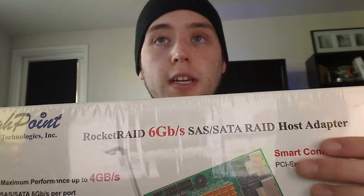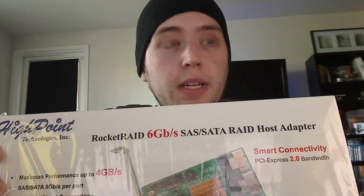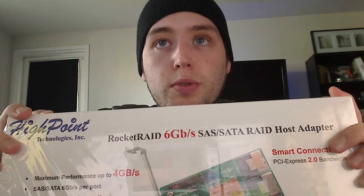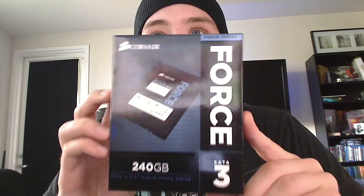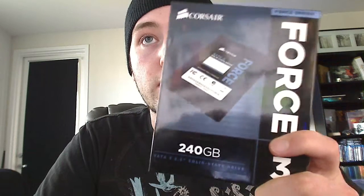It's got a maximum of four gigabytes a second. There are cheaper RAID cards around $34, but they only take up an X1 slot instead of an X8 PCIe slot. The problem with an X1 is that you can only get around 300 megabytes a second. So when you have a true SATA-3 card, you don't get the full performance out of it unless you have something on an X8 or X16. Whenever you look to buy a RAID card and want to run SATA-3 close to spec, you need a lane that can be devoted to it.